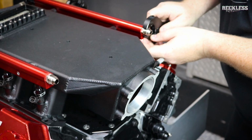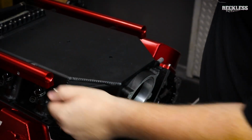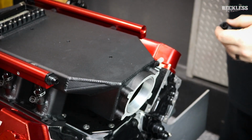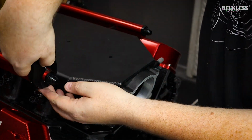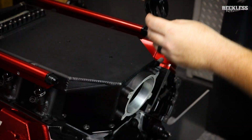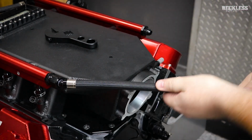So like I mentioned, they were able to hook me up with the fittings also, so this wasn't really part of the plan. I'd never planned on swapping everything over to black, but fortunately they had everything in stock. Everything's all the same brand, XRP, so it matches. It pleases my OCD. I can't stand when you have different brand of fittings and the anodizing is different shades of the same color. It drives me up a wall. So we're going to swap all these fittings out and then do the final assembly on this with the new PTFE lined hoses, which are safe for ethanol and methanol.